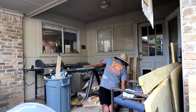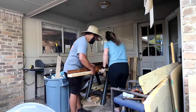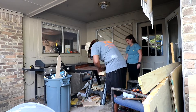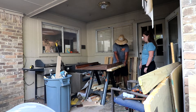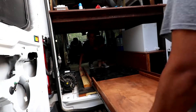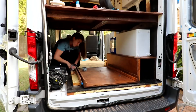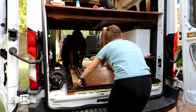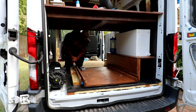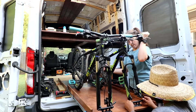Since we couldn't finish the ceiling, we moved on to finishing the bike rack. We're adding extra structural support so the side railings have more wood to screw into — making sure there's no flexing or bending and everything is structurally sound. The board and rack are quite heavy, and adding bikes adds significant weight. The rails support up to 700 pounds, so we're not worried, but we wanted to be cautious. Here you can see us test-fitting it in the garage — it's a bit bigger than expected but fits our gear and bikes really comfortably. HP secures everything to the floor of the van.